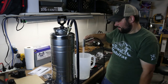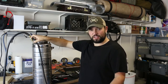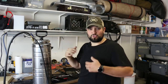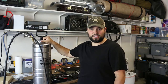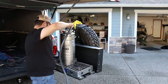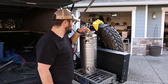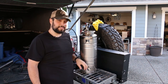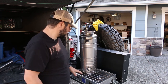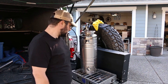It's a new day. I've got the shower pump sprayer built and tested from last night — no leaks. Now I'm going to fill it up with water and see how long it takes to get hot, also testing whether I can directly heat it with the stove attached to the swing-out. Water temperature right now is about 68 to 70 degrees — roughly what you'd get from lake water on a summer day. I'm going to fire it up and see how long it takes to get roughly three gallons up to 100 degrees.